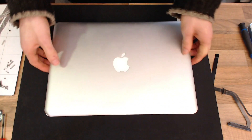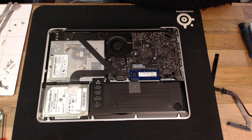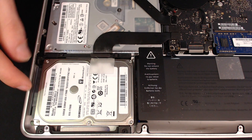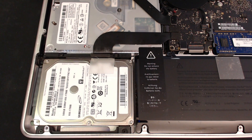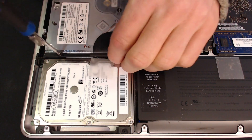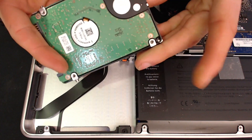I'm going to show you how to replace that. Turn the laptop off, turn it over, take out the screws on the bottom with a 00 Phillips screwdriver, and that will get you inside. This is the part we're interested in — this ribbon cable. It goes along here, under the hard drive, and it connects to the SATA connector here, and it also connects to the front light and IR sensor here. First, remove the hard drive by taking out these two screws and removing the locking bar. Then the hard drive will lift out like so.